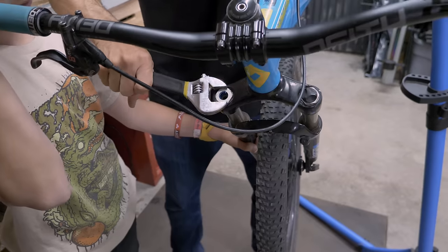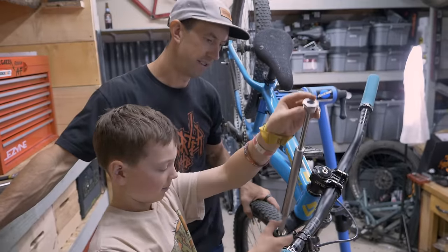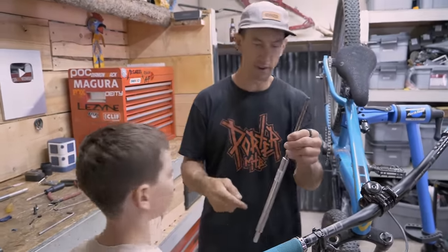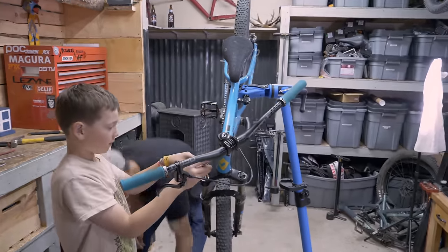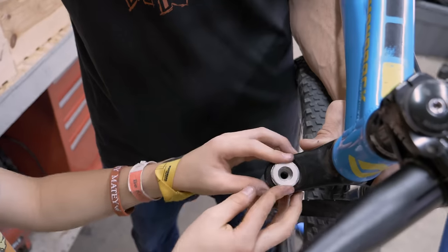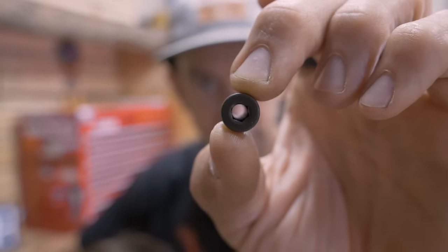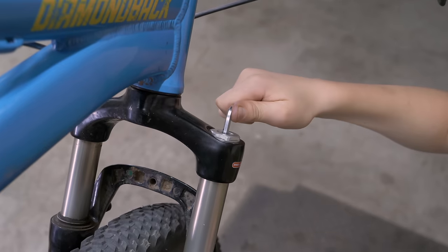Turn it vertical and spin it. Now take the top cap off and rotate the bars just a little bit so it can come out. We've got a new cartridge damper - all the oil and everything that controls the damping is inside this little tube, so it's pretty dry in there with just a little lubrication. Snug up the bottom screw, remove the broken piece, then screw in the hollow bolt. That hollow bolt is where your adjuster screw goes through to turn a thing inside the damper to control your lockout.